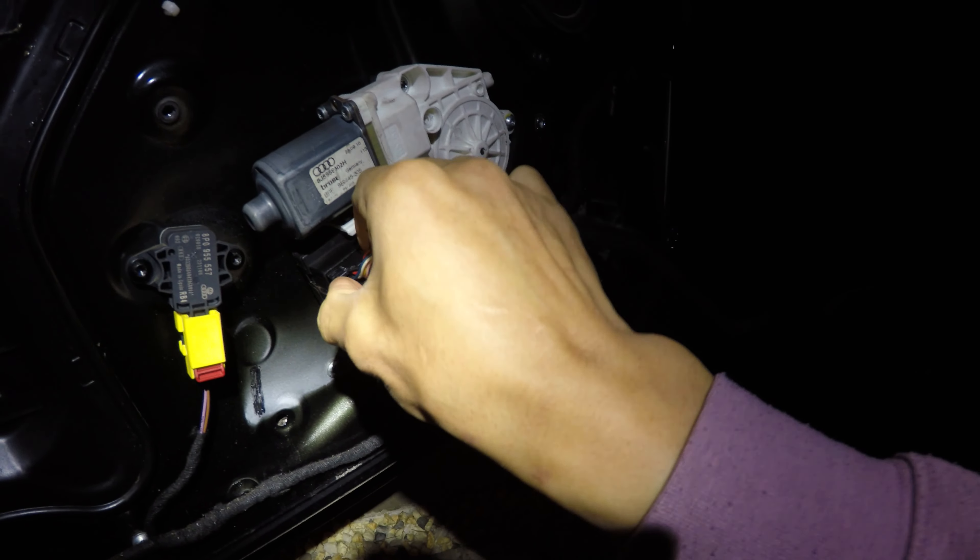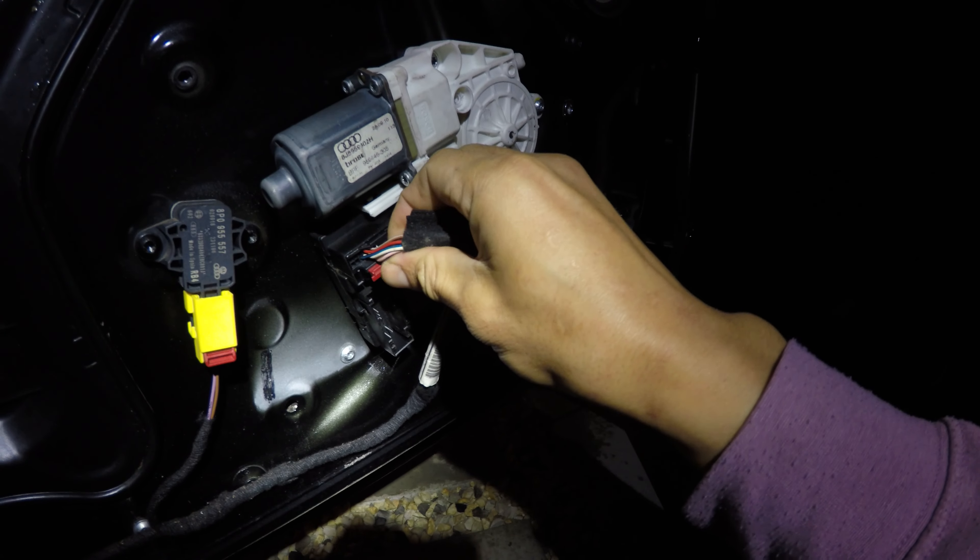First thing I needed to do was sort out the adjusting of the left side mirror for removal. The door control modules have a special plug where the red lock needs to be pulled out first before removal. Next is plugging in the folding mirror to adjust it for removal. It's recommended to adjust the mirror all the way towards the center and down to give a pry tool access from the top. Once adjusted all the way in and down, get your pry tool in there to remove the glass.